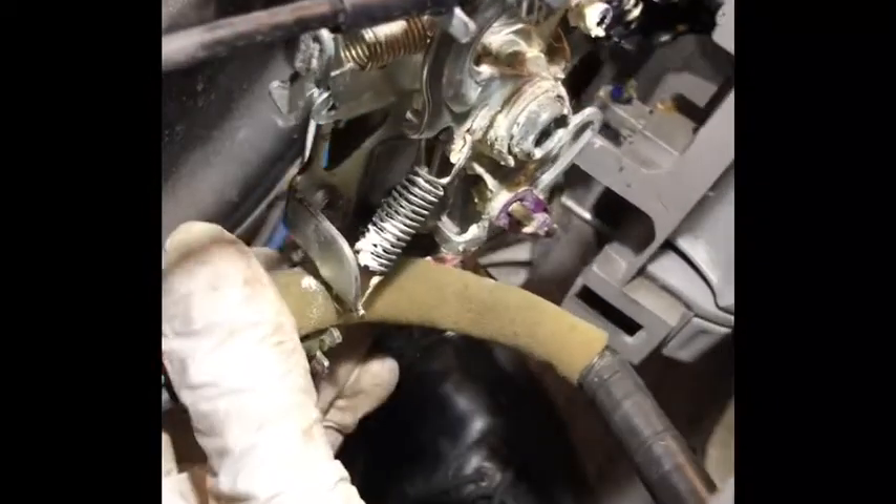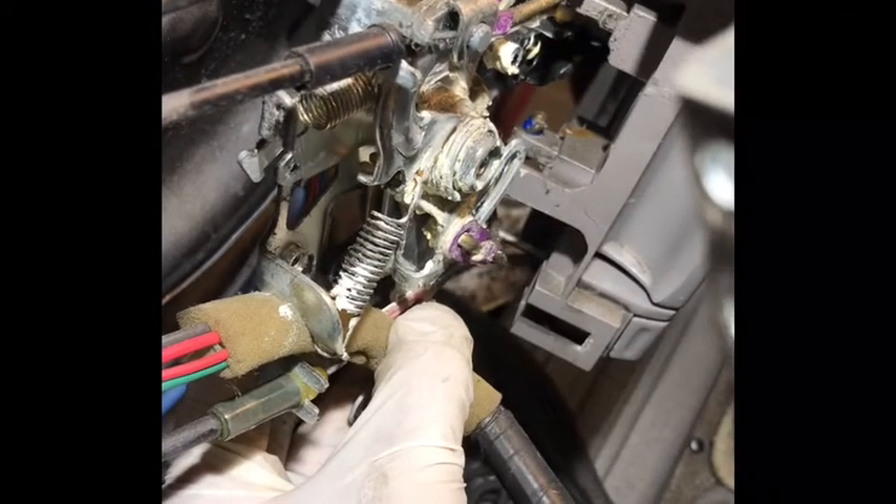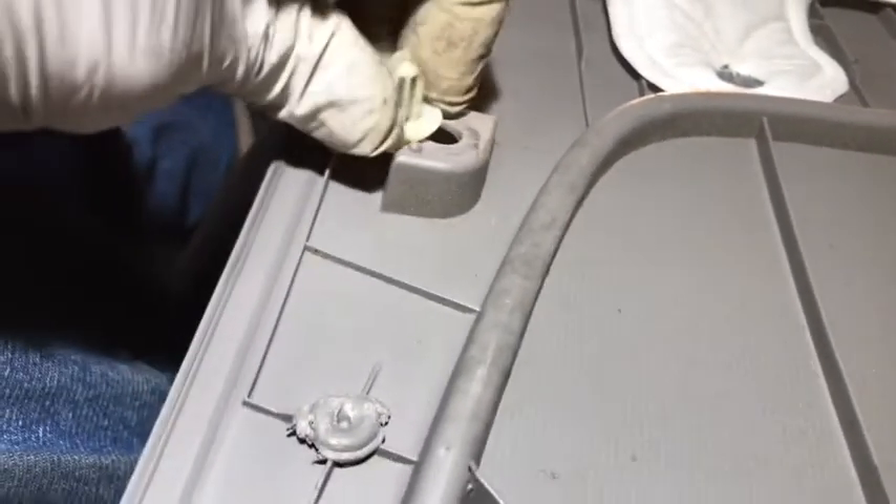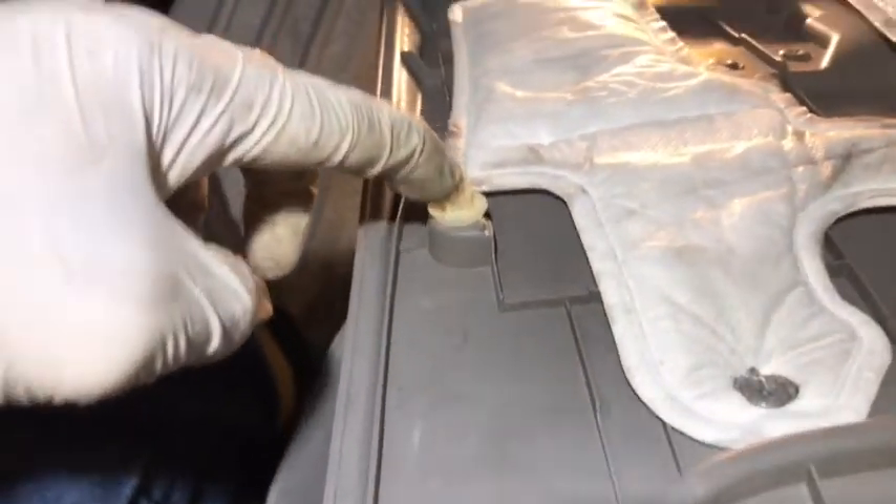When you put it back, these things go this way. See the purple connector and the pink connector. Take them one by one — take the purple one off first, then put it in here; take the second one off and put it in here. Take the pink one all the way down and put it in here. That way you won't miss anything or get confused. If you take everything off at once you might get confused — or just take a picture with your phone first.